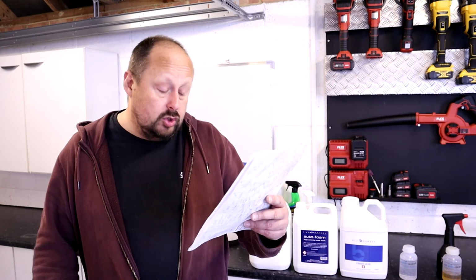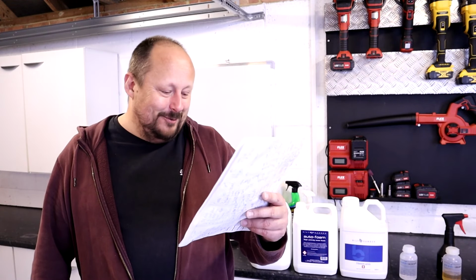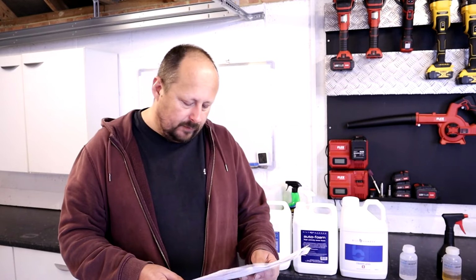Surfex HD also contains corrosion inhibitors. Okay? So it inhibits corrosion, which is an important attribute of something, especially if you're going to be using it to clean the undercarriage of your car, or cleaning ferrous components. Some caustic but more pH neutral detergents can promote corrosion in amphoteric materials. And I've seen that for myself. It can be quite a big difference.